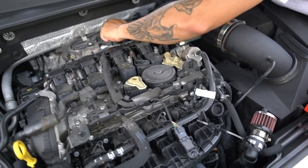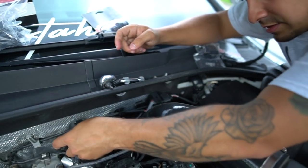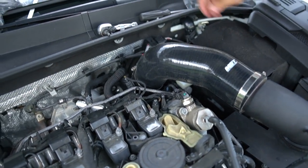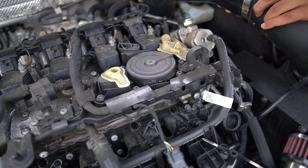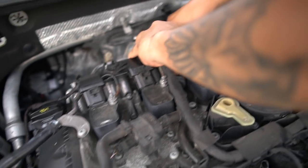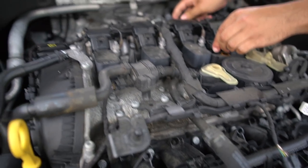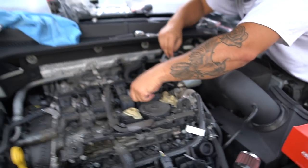We got to take off the turbo inlet, like George said — JSM K7 has done this before on his oil catch can as well. We're actually going to remove the turbo inlet pipe. He actually wants to remove the whole intake first, which we have to also do. What we're doing now is lifting these up a little bit — these are the ignition coil connectors — so that we can get the PCV hose from underneath.